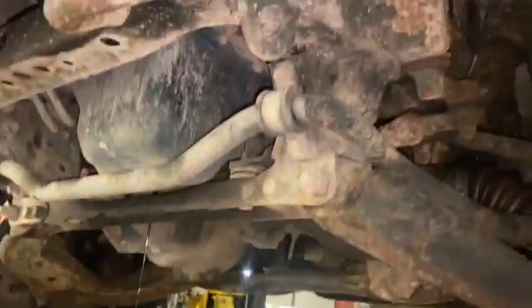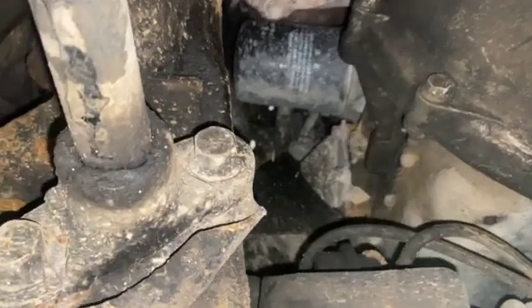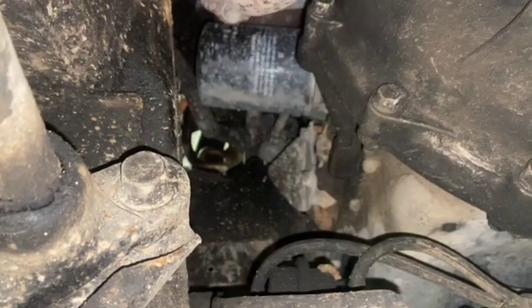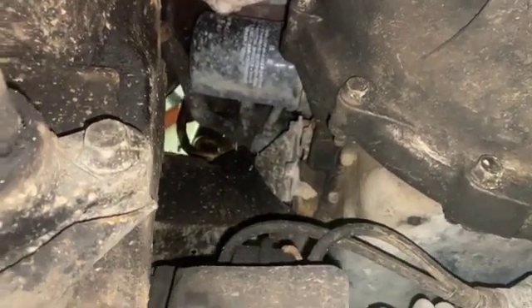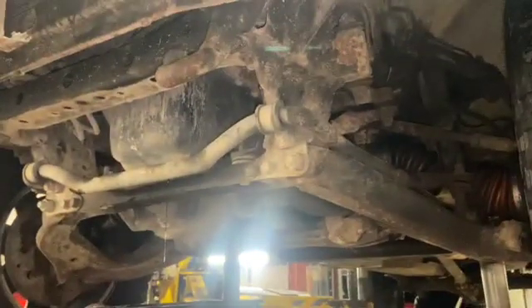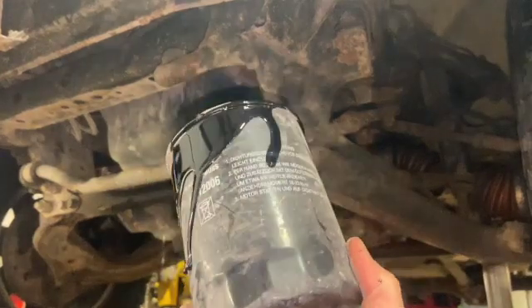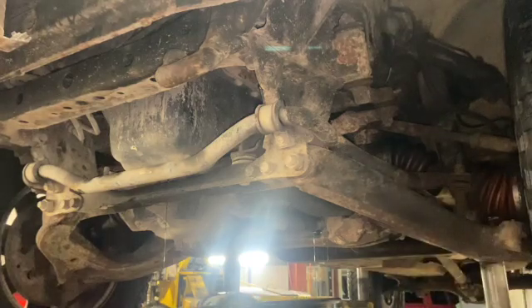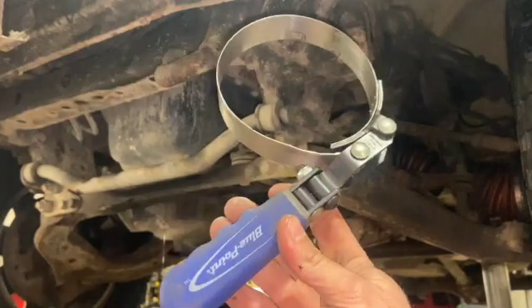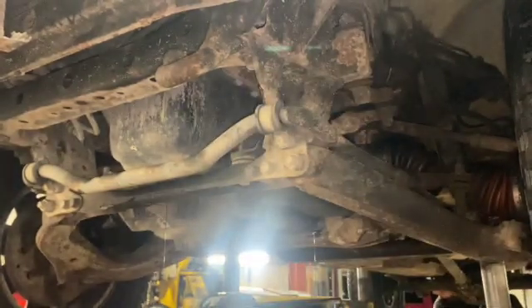While we're leaving that draining, the oil filter is normally easy to access around the back, looking up the side of the gearbox — that's where it's located. Hopefully you might be able to get it off by hand, but if it's too tight we'll use a filter wrench tool. I'll put a link in the description below to some filter tools — they can be quite handy bits of kit. That's the old filter out — it actually came off really easily. You often find a lot of people do them up far too tight, and honestly 90% of the time they're too tight to get off by hand. Luckily I got that one off by hand tonight.